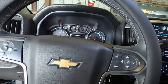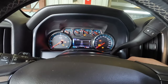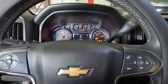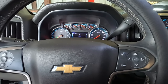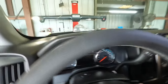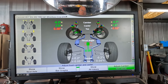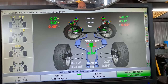A little up to the right — straighten that out, put it in park. Get my wheel nice and straight. 71,000 miles — wheel's dead straight right there. Lock that. Let's see what our specs look like. We've got a lot of toe-in in the front — it's about a degree and a half of toe-in.